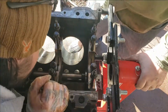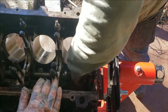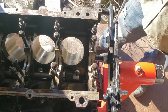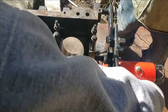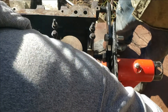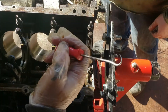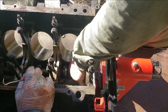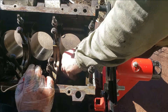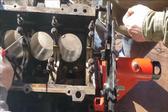You can take a little allen wrench or a colored pick and check the oil gallery hole. If this fits through, then you know your oil galleries are lined up and you'll have good oil pressure. If you block them off, your motor won't last. So be sure to line all your oil galleries up.